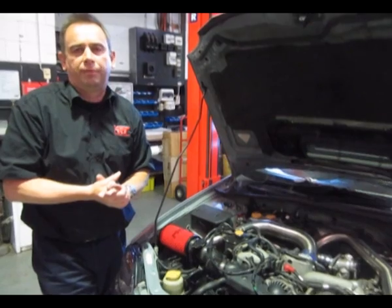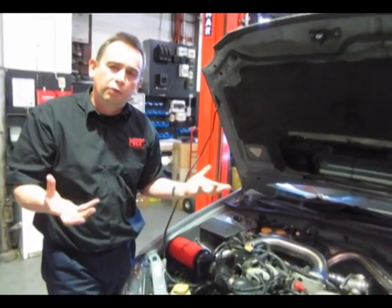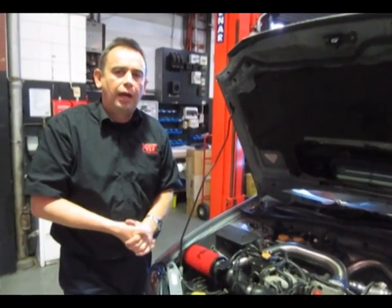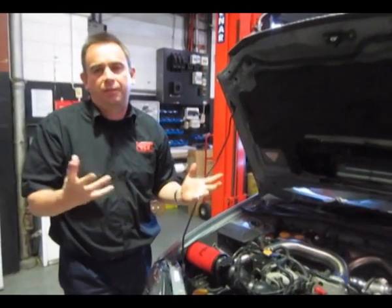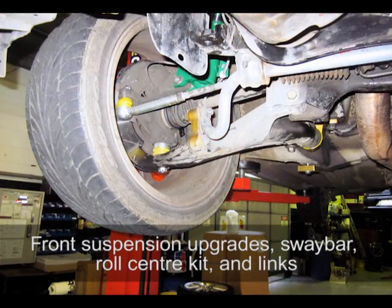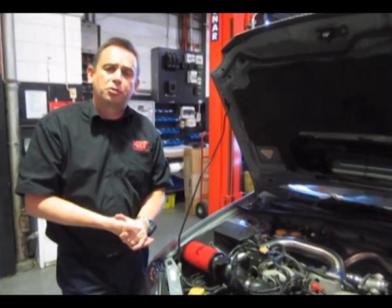Remember on this particular car, if you're upgrading it there is still a theoretical limit on the internal reliability of the engine. Think about the up-pipe to the turbo from a reliability point of view, and make sure the car is properly serviced. As you can see from these pictures, all the individual parts have been fitted — front and rear struts, adjustable strut tops, brake support bracket, front mount, anti-lift kit, rear sway bar and links, brakes, and more.